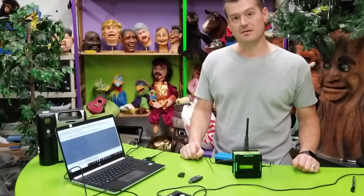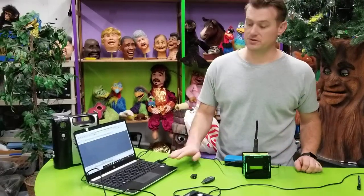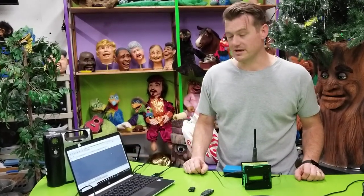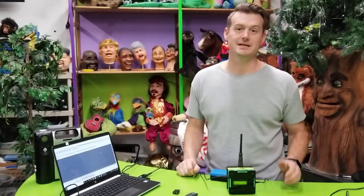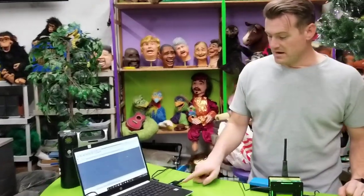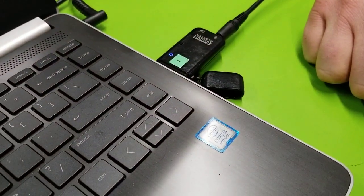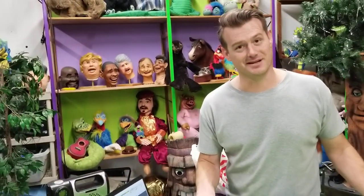On a lot of laptops, there's been the ability to run our program-out audio feed directly into the computer's built-in microphone input, and then we've been able to control the volume in Audacity to get the proper input gain. I have an external sound card hooked up because this specific laptop does not let us plug a microphone input in and control the volume — it has a built-in microphone, which isn't helpful for us.